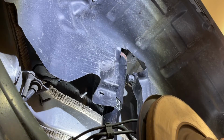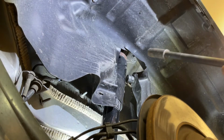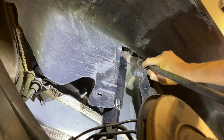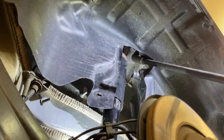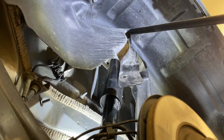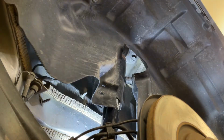So we're just going to grab our torque wrench, 37 foot-pounds for those 16 millimeters. So I grabbed a long extension and a straight socket. You don't want to use a swivel when you're torquing something down. So we're going to see, the long extension just helps me to get the torque wrench handle way out of the way here. So we've got this pretty well tightened down, so we're going to just try and get it torqued now. Get this one torqued. All right.